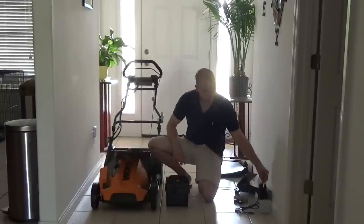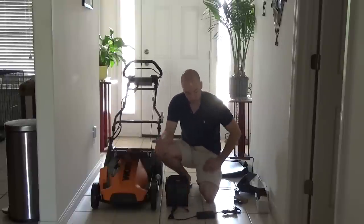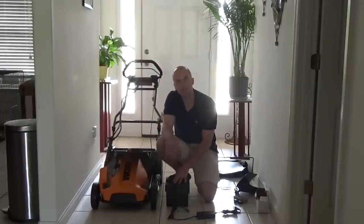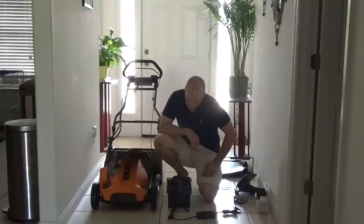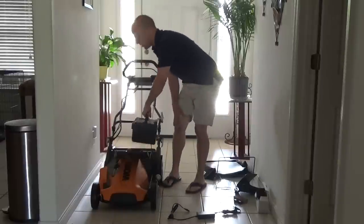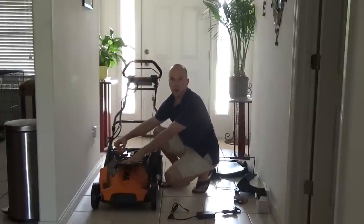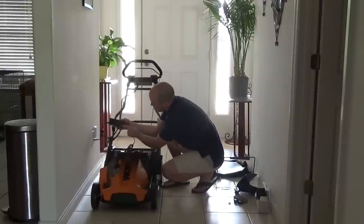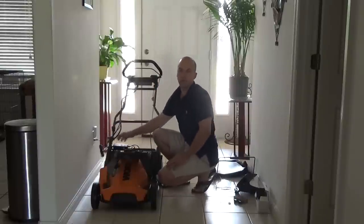Here is where you'll plug in your charger. You would leave this in the garage — you don't have to, like with older lawn mowers, stretch an extension cord across the yard. That's the beauty of the battery. This weighs 29 pounds, it's 36 volts with an 11 amp hour rating. You don't have to take it out of the container every single time you want to charge it. You just set it in, and there's an orange plug — that's for when you want to operate it, and when it's in the garage you plug your charger into that same spot. The indicator will let you know: green means fully charged, red means it's charging, and if it starts flashing red, that means you have a bad battery and will need it replaced.